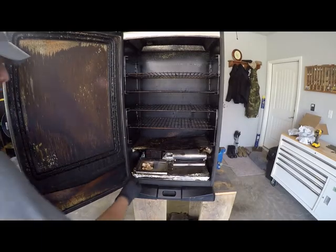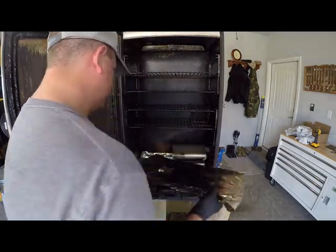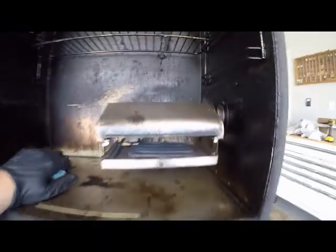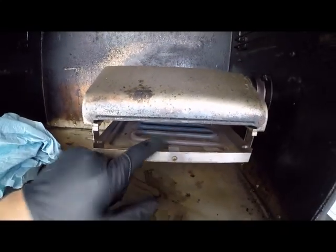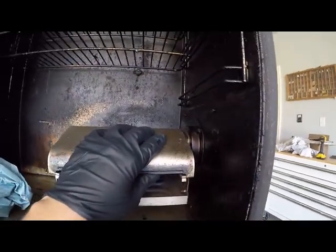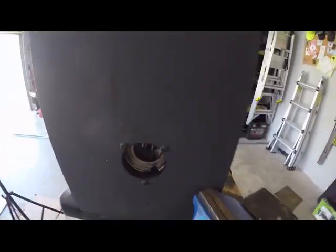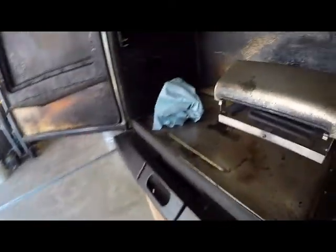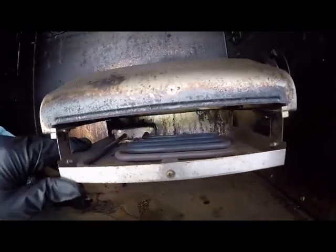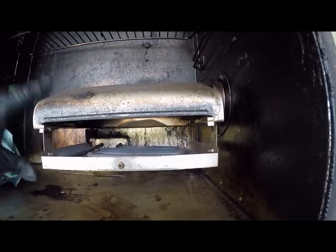Let's first remove some of this stuff. There's a clip right here that goes over top of our element. The cover for the smokehouse has three screws over here that we can take out. And then back here in the back, it looks like it's just sitting on top — that's really the only thing holding us in. So one screw here, three screws over there, and then this cover should come out.